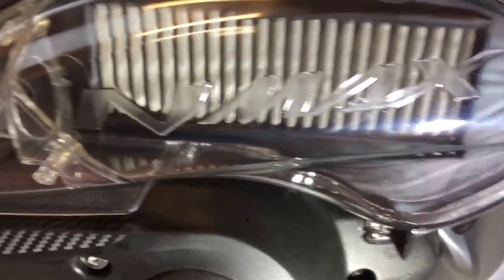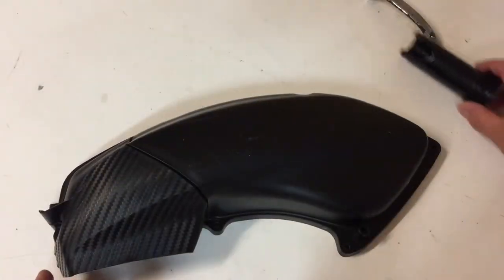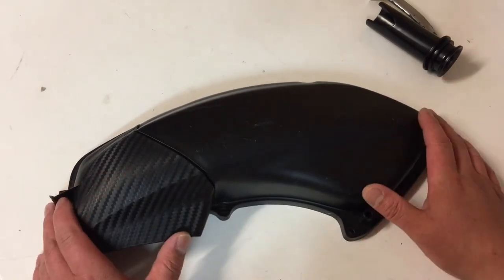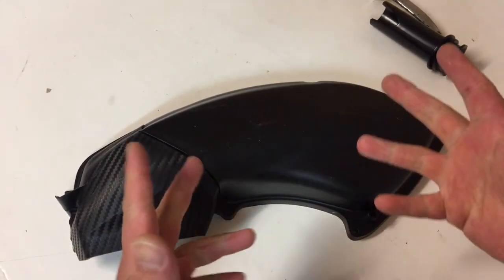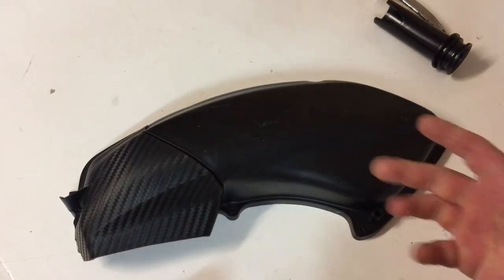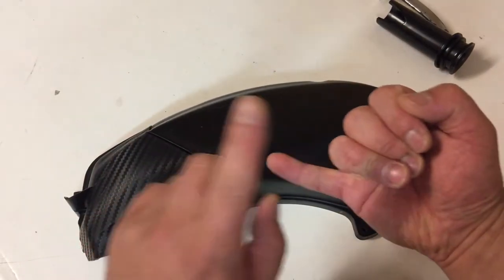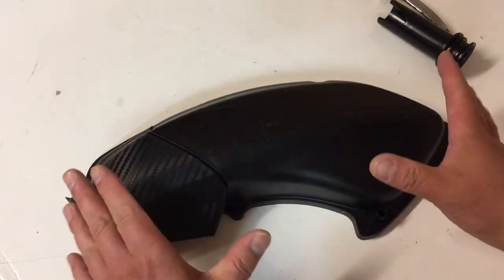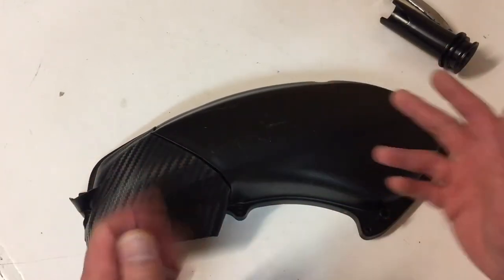On mine you can see I have removed the snorkel, and if you look closely you can also see I've enlarged the inlet hole. I'll tell you why I've done that. So let's talk about the problems with this kind of design — why does almost everyone go to modify their air filter element, or the air box, or completely remove it and replace it with a racing air filter or a filter pod? The countermeasures in this design to keep out dirt, moisture, and foreign bodies are very constrictive.